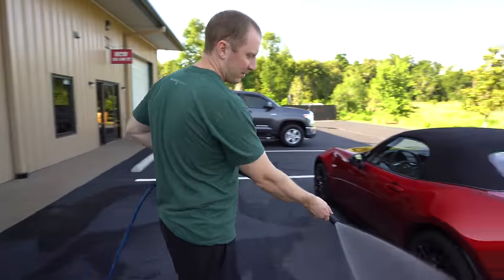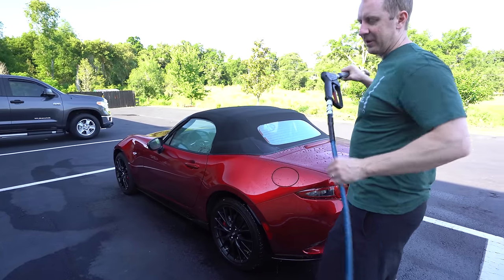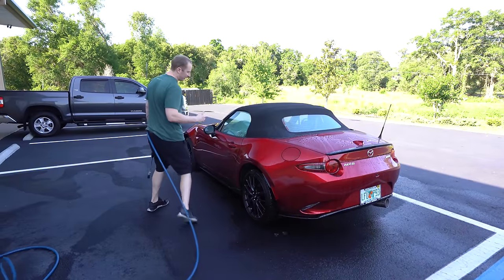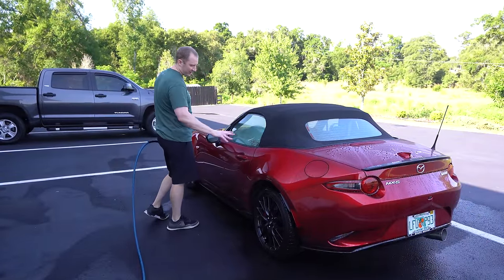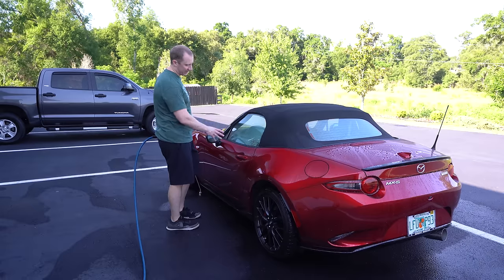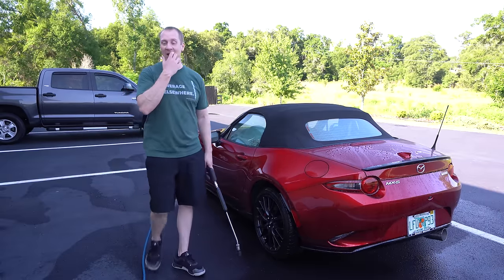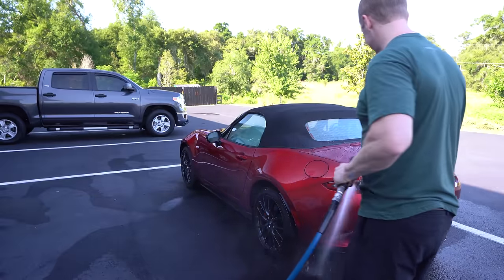I like this concept from Dylan von Kleist and Rupes — wash from back to front, against the grain of the car. Think about it logically: as you're flying down the road, dirt hits the car and embeds in that direction. Whatever microscopic scratches and imperfections are in the clear coat, dirt grabs that way. Pressure washing this direction may knock down another percentage of junk off the surface. Certainly can't hurt.